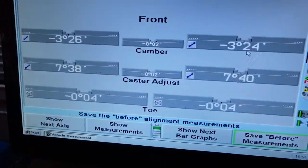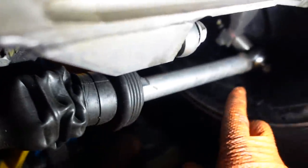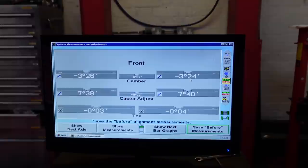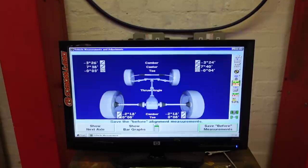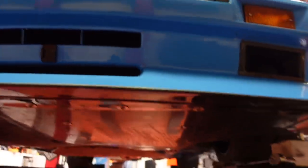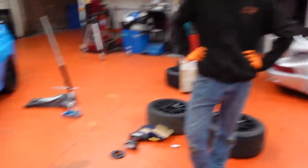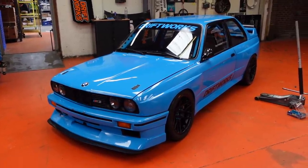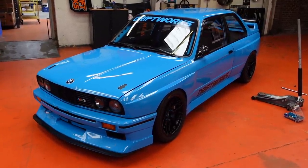What a mega faff that was — nobody to blame but my own design. We've got a Titan manual steering rack here; it's quite difficult to get to, quite awkward adjusters, no turnbuckle on the outboard end. We also made access completely impossible by fitting the undertray and bolting it up before doing the alignment. That was a bit of a fight, but we have perfect alignment, all locked off and ready to go. The Hunter alignment machine is now fixed, working perfectly, and tested on my most challenging car to align. Steering wheel's straight — it's all good.